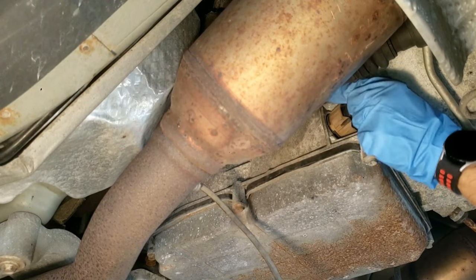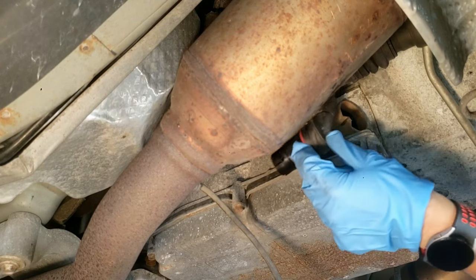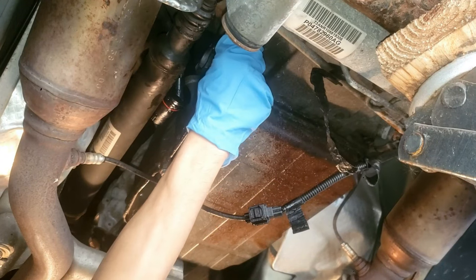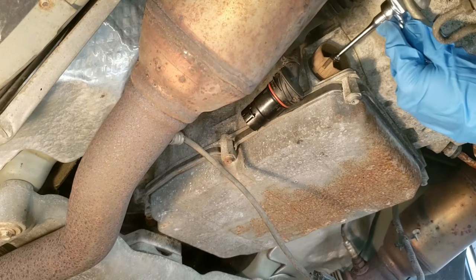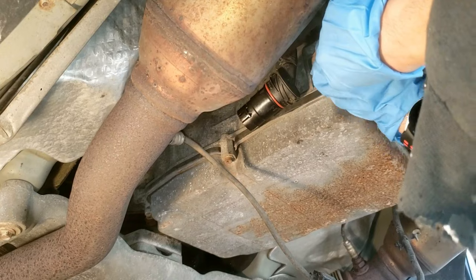Get your oil pan ready. This is the electrical connector wire sensor — just pull it out and place it to the side. Remember the position of this when it goes back in. Next, grab a seven-millimeter deep socket and an extension with a small ratchet wrench. You'll feel when the socket is grabbing onto the nut inside, then go ahead and loosen this. By the way, the nut does not come out.